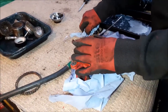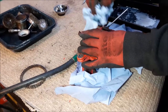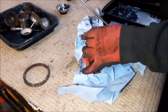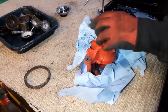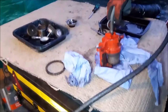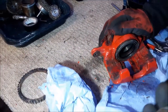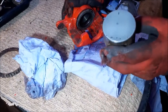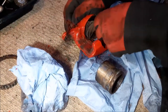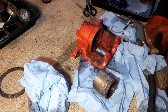We're continuing to clean the other side, but I just thought I'd show you this — when we got the piston out of the other caliper we used a punch and pushed it out, as we guessed it would be seized which it was. But one way you can get them out, especially if they're not seized, is to use compressed air, which is how we often get them out. And that's it — popped out. Even that one, which wasn't giving us problems, has still got a lot of rust in there, so even that was going to be a problem eventually.